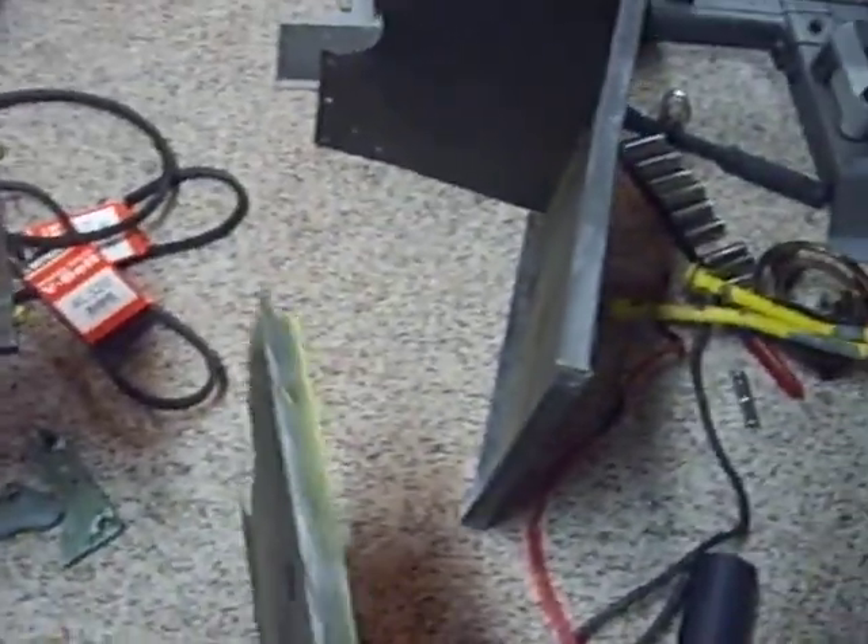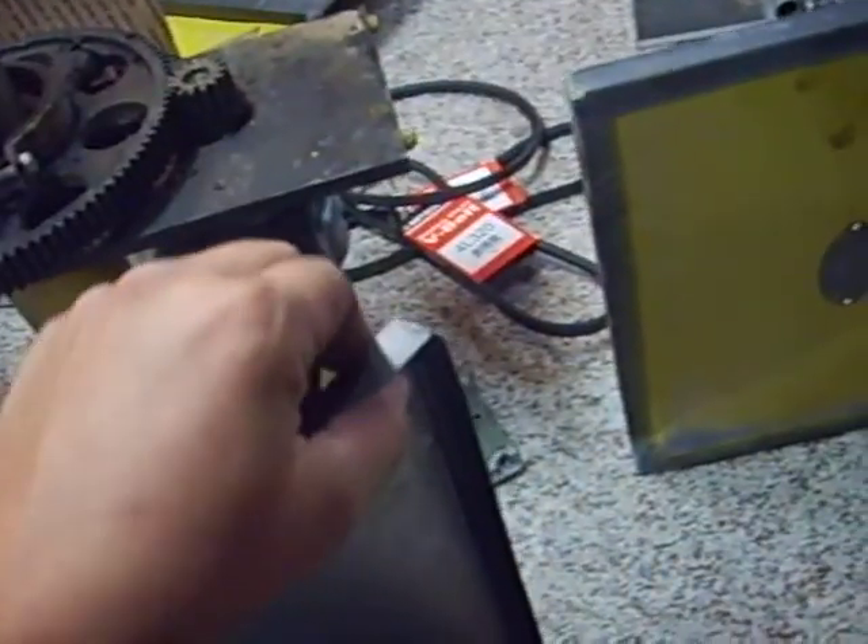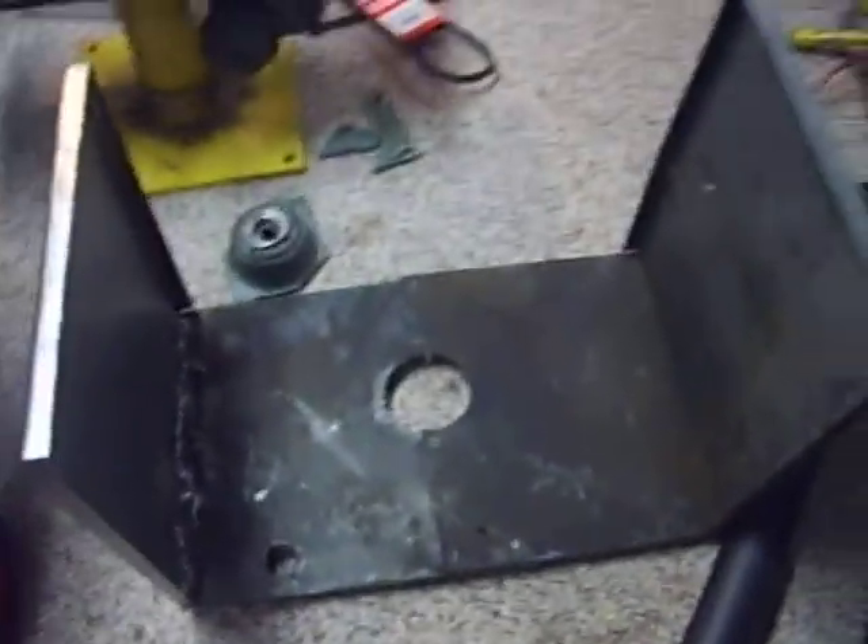Sheet metal update: I stayed in town so I got to hammer them and got them pretty much straightened out. This one here was the one that was super mangled — had the side sheared out on it. I hammered it as best I could but still wasn't satisfied, so I cut that portion off and welded a new portion on that I made. I still have to get a light grit flap wheel and finish that rounded corner, but after it's done it'll look like one piece like it did from the factory. I did the bends on the brake at work.